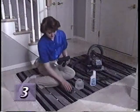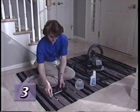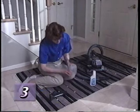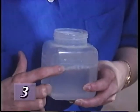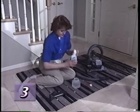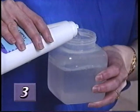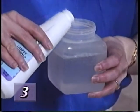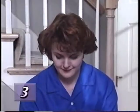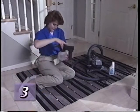To set up the portable shampooer, attach the shampooer cap to the end of the sprayer. The jar should be filled with warm water to the line marked water, then filled to the second line with Kirby carpet shampoo. Use only specially formulated Kirby carpet shampoo for best results. Screw the jar and portable sprayer together tightly.